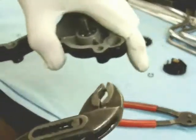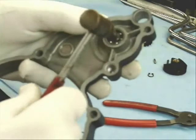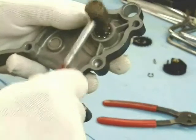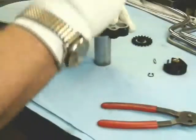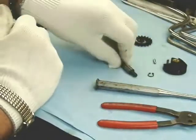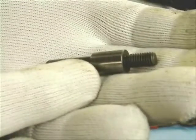You may be able to remove the water pump shaft just by pressing on it with your hand, but I have a small bronze hammer — a tiny one I call my pecking hammer. It doesn't make much force, just coaxing it won't damage it. When it's almost out, put a drift down in there and give it a couple taps with the pecking hammer and the shaft comes right out. The polished area is where the seals are.